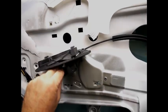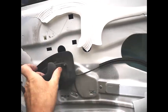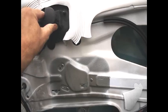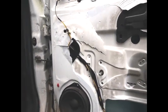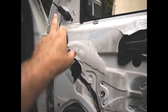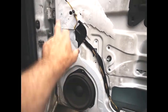If you look just here, this is the handle section — these clips have to be located properly or the handle won't actually work properly. So make sure that's located properly firstly. Make sure you put your wires back and don't get them lost inside the door — make sure they're taped up. There's a popper here, a popper here, and a popper over there.